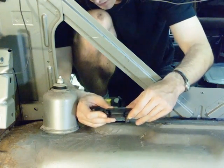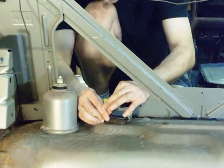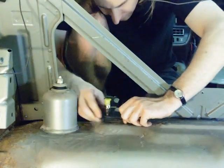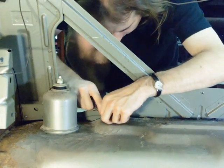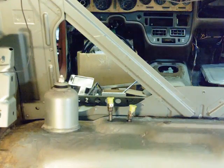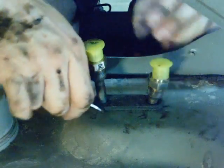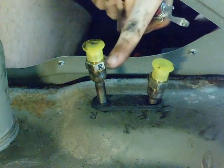This is the stock fuel line rubber bushing — it came with the car. I just cut some little slits in it so it will fit around my new fuel lines, and it seemed like the perfect thing to use to protect the lines coming into the car. I just somehow wrestled it in there. I think it's designed to go in from the bottom up. I not only made the feed line a bit shorter to make sure it's differentiated from the return line, but also labeled it on the car and the line itself.